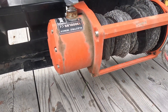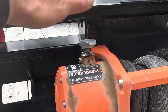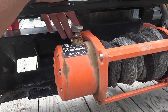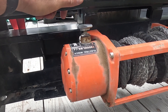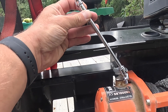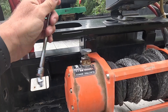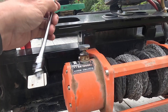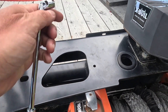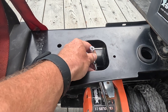What I need to do is move the winch clutch handle from here to somewhere up here so I don't have to reach through this hole and awkwardly try to engage and disengage the winch when I need to pull the winch line out. I'm going to take some quarter-inch socket fittings, two universal joints, and a shaft, and make an adapter for the winch. I'm going to remount the handle somewhere up here — make a plate that sits there with the handle coming through. I just have to figure out how I'm going to do that.